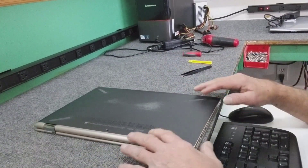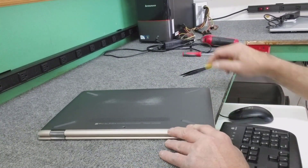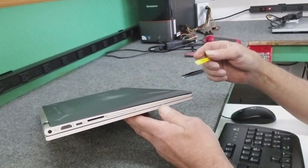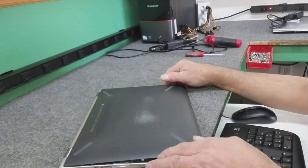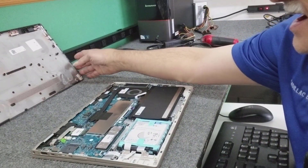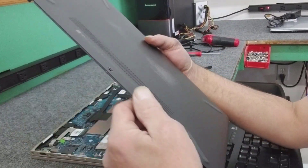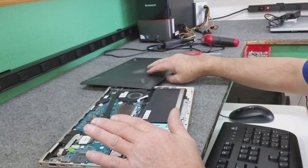To open this up we're going to remove the bottom panel. Just get your tool in there — in my case I always use my little finger to get it started. Pop it up along the edge, it breaks loose, and the pan comes off fairly simply; just jiggle it carefully. Now when you put this back on, along the very back edge there are little tabs in the corners — those have to slide back underneath, so you get the back in first and then snap it down along the sides and front.